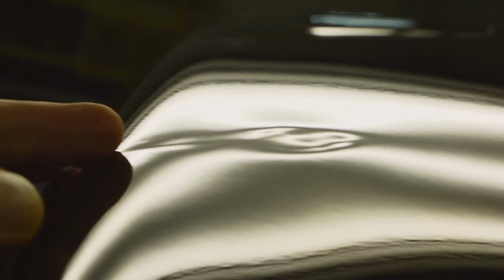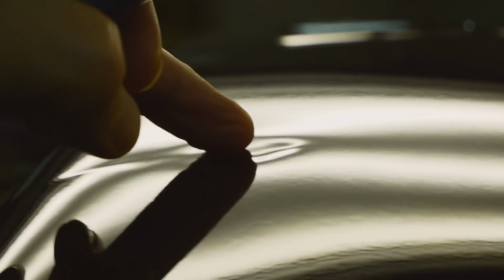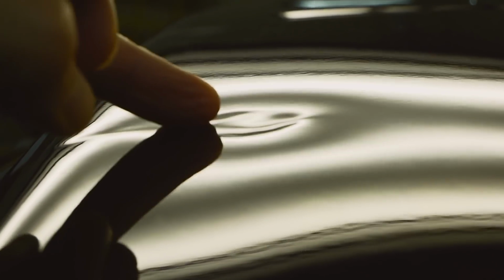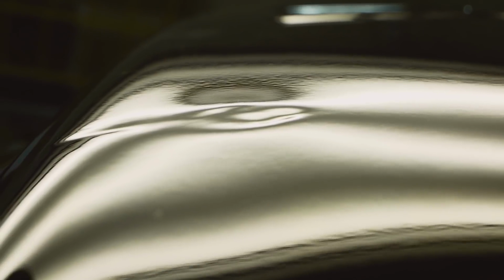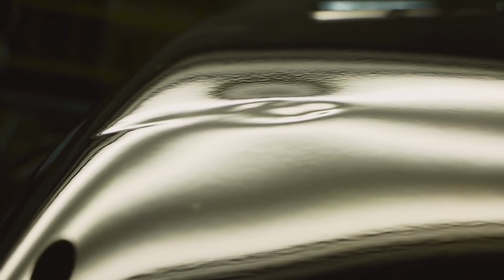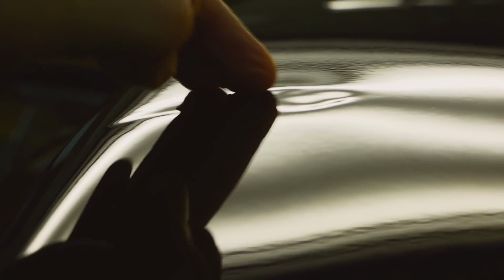you can see just tapping that edge a bit brought that back up, and it's still not quite tight enough. I think I need to shrink up the bottom of this a bit, but obviously the strength in the dent is from that edge that holds the metal. See, every time I take some of this, kind of push that edge back in there, look at the strength that it has now.